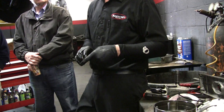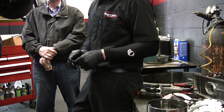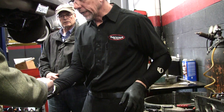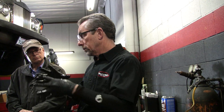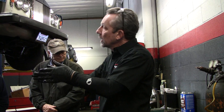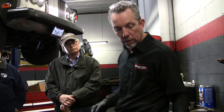How about parts for these — like the new seals and the new packs? The soft parts are pretty easy to get. The hard parts are hard sometimes. Pumps — I've had drums just explode before. These are brand new release springs — these have been replaced, you can tell. When they get cooked and they're old, they're discolored and they're shorter, sometimes a little tweaked. If these springs are weak, remember I was talking about the 3-4 shift where things come on and come off — if the springs are weak, this one's not going to come off that quick. So if there's a delay coming off and the band clamps on the outside, it's going to make it worse — it's going to burn it quicker. So unless the springs are really good looking, I always replace them.